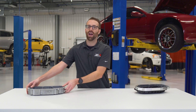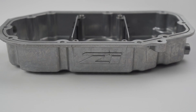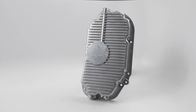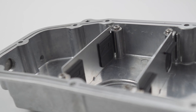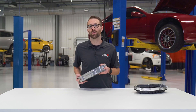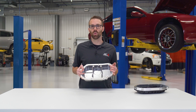This is where our new baffled oil pan comes in. This pan is a full cast aluminum lower pan replacement. It will replace your factory lower pan and it will also replace our oil pan spacer for those of you who have that already but are looking for the absolute best possible oil pan solution. We brought over the same features from the pan spacer: it's got turbo drain returns, a temperature sensor port, and increased oil capacity by 0.8 liters.